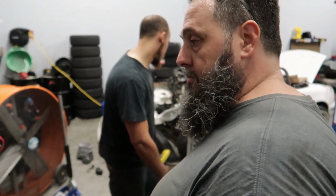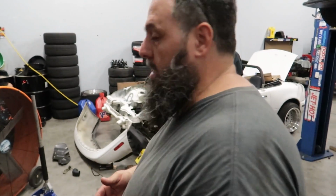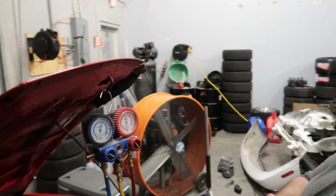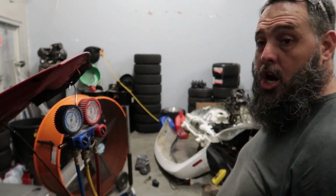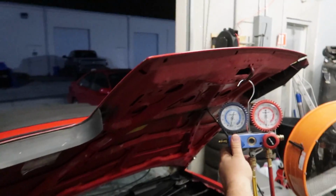The same way I'm going to vacuum it for 15, 20 minutes is the same way I'm going to let it sit for 15, 20 minutes, to make sure that it's not going to go down. Right, because it could be a small leak. Yeah. And you want to see that in that 15 minutes that it actually hasn't budged. Correct. I mean, the longer the better. I mean, you have 30, 45 minutes to burn. Yeah. No problem. That's what I typically recommend. I always recommend 30 minutes to an hour of vacuuming and sitting, and then you'll know if you got a problem. All right, cool. Yeah, well, let's do that then. We want to make sure we don't have an issue.